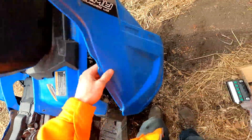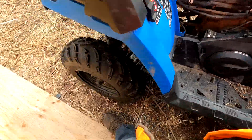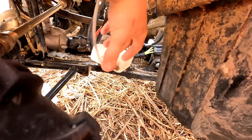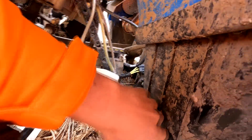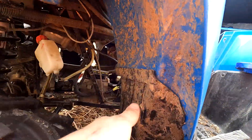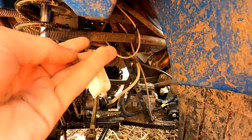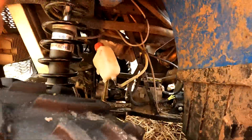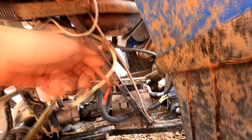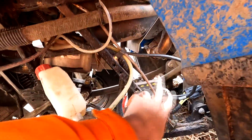If you haven't already taken off this panel — like I said, it's the two pop pins right there, pop them off. Then going in here, you have to unbolt your coolant container — I'll leave it hanging just like I did. Get in here for the battery. She's a bit chewy — you can tell I haven't washed her, because in winter I don't wash her. This is all from winter mudding. If I take the pressure washer to her in winter she'll just freeze up. But now it's summer again, I'll probably get the pressure washer out and clean this pretty soon. I need to undo the battery bolts and take her out. There's normally a strap that goes over and clips in here, but mine's gone — I probably took it off while I was working on it in winter.